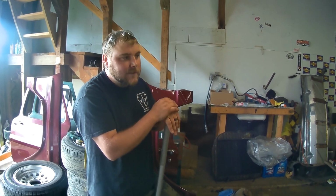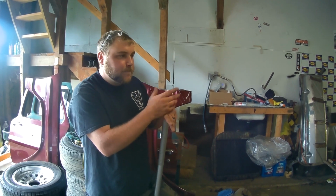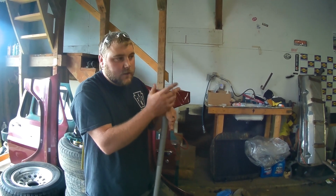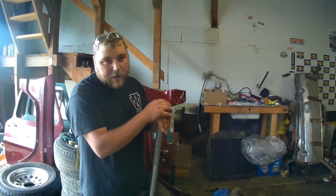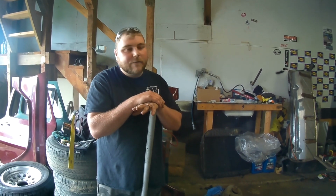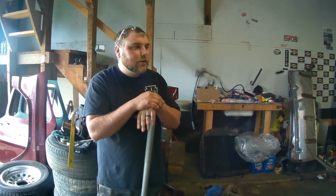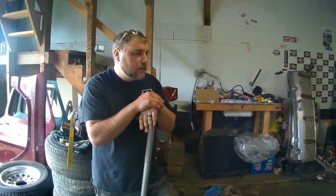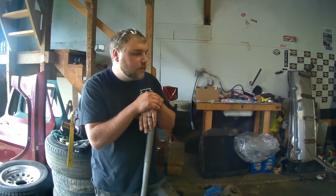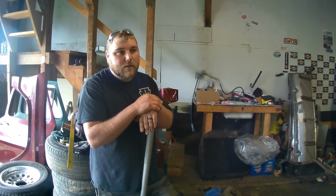The truck started as a 360 4-speed with a T18 trans. When we're done here, it's going to be a 390 FE big block, still saying FE, but with an NP 435 4-speed top loader transmission. The motor actually came out of a 65 Mercury, so still an FE block, just dressed as a Mercury. But yeah, it's going to be a fun truck, somewhat slammed on the ground. It's going to handle, it's going to ride good. And it's going to do burnouts.